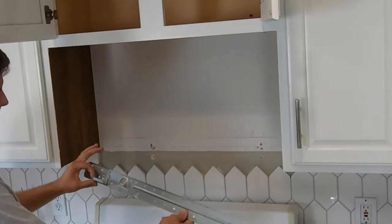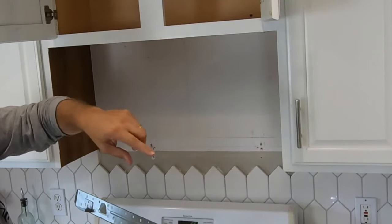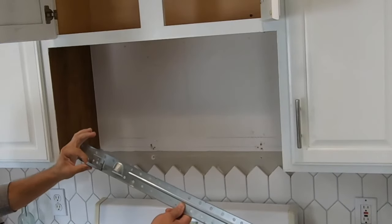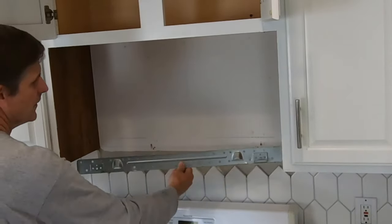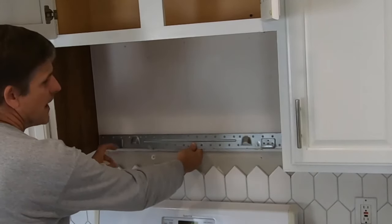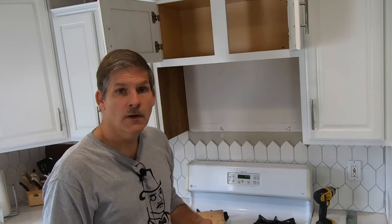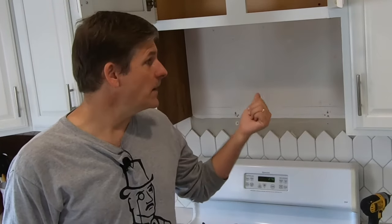If you were mounting this, you just measure from here to the bottom of the cabinet to get the height — the back of the microwave rests on the bottom of this hook. That determines the height of the mounting plate on the wall. Once that's on the wall, you can just hook the back of the microwave in and screw it in from the top. Hope this video helps. If you found anything useful, give us a thumbs up — we always appreciate that. Don't forget to subscribe, we've got lots more videos coming. We're going to follow this one with how we put in the range hood. Thanks a lot for watching and we'll see you in the next video.